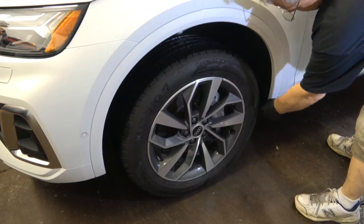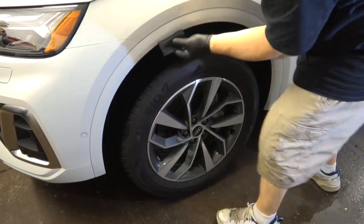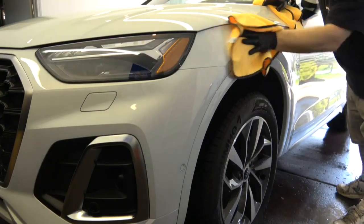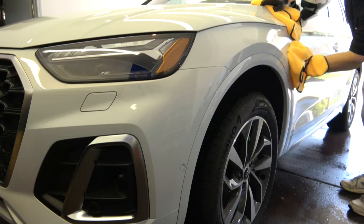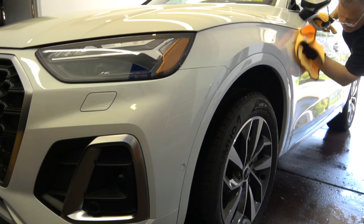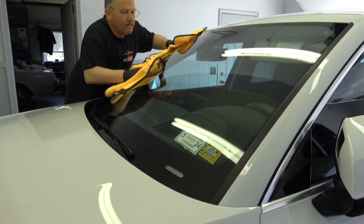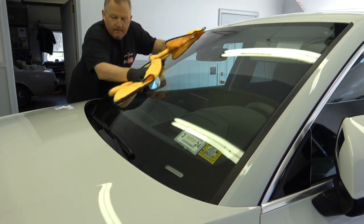Work very deliberately — pick a panel and complete that panel. I did all four wheel wells at the same time. After finishing the entire vehicle, I went around it again with two microfiber towels using sunlight to check the reflection and make sure all remaining ceramic coating was removed with no haze left behind. Any haze will cause streaking. Since it's a hydrophobic coating, I also applied it on all the glass, lights, and reflectors — it works great on windows, mirrors, and even shower doors.